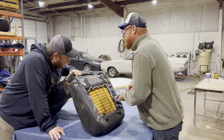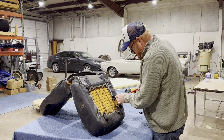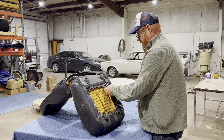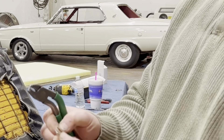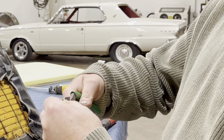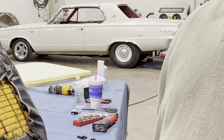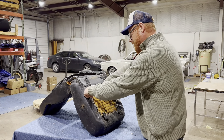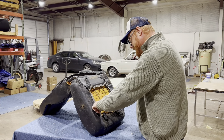That's my buddy Ethan — he works up at the shop. They use something called hog rings. I just gotta cut them all free. There are a lot of them and that's what holds the material to the framing of the seat. I'm just going around cutting them all — it's good to have a good pair of side cutters or dykes. A hog ring is what you use with special pliers: when you crimp it, it closes together and holds everything. They're used quite a bit in the upholstery world.